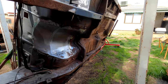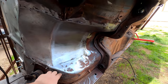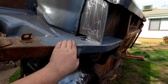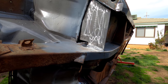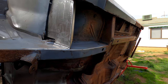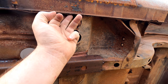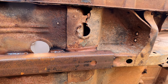So we're out here on the rotisserie — the trans tunnel's in and sanded up. The factory's never flat or smooth so it's the best we can get it. We repaired this rail and put a new rail in, but in turn that meant we had to take out this splash pan. I've prepped up a new splash pan, put it in, and finished up the end of that sill this morning. Moving on, the next patch panel to do will be this one here — I'll try and split it off the inner sill along here and put the dimple back in it.